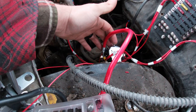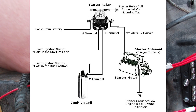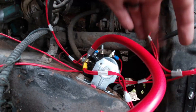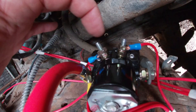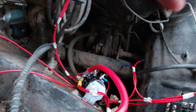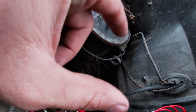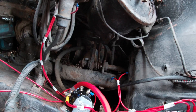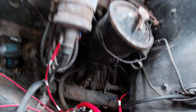After the alternator is done, mount your starter solenoid. On the solenoid it's going to tell you where to connect things — this one says ignition, this one says starter, here's your battery, and the other side goes down to your starter. The left side goes straight to your battery. The ignition terminal goes to your ignition coil. While you're cranking the engine, your coil is going to need a ballast — a ballast goes from 12 volts down to 6 volts because the coil cannot have 12 volts constantly running to it. Momentarily while you're starting and there's a draw from the battery, it'll send 12 volts directly to the coil to help start your car faster.